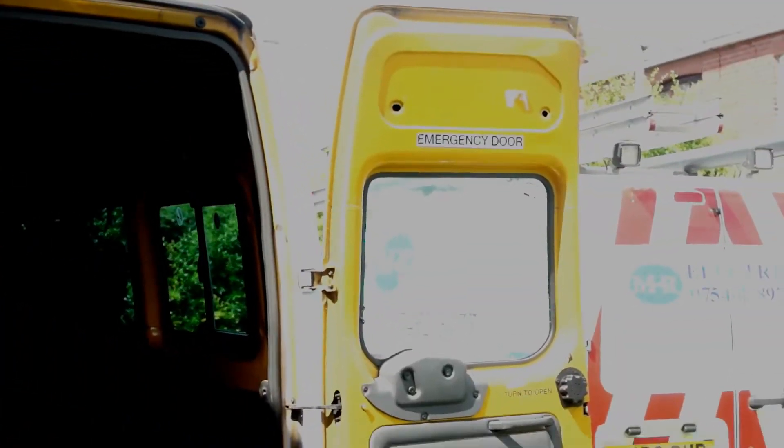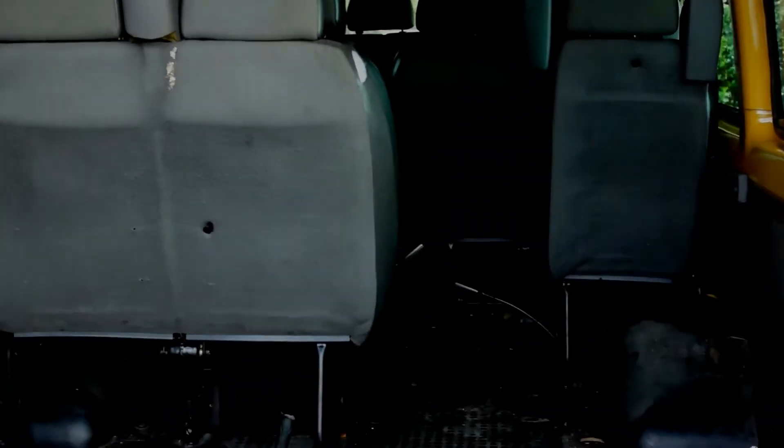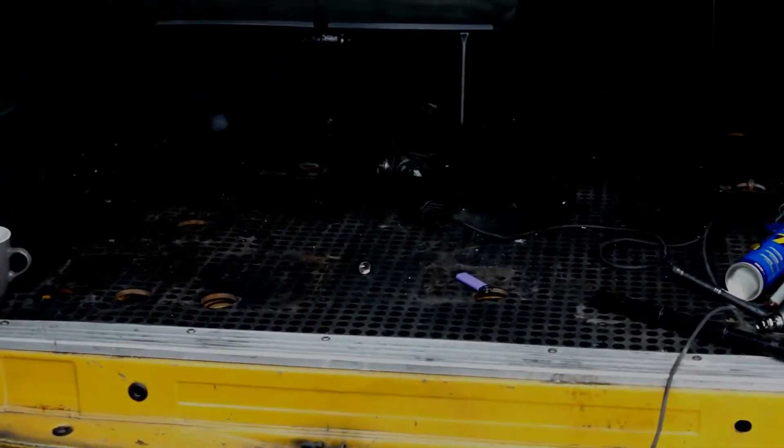As you can see, all the doors are yellow on the inside, which doesn't matter because it's going to get covered in carpet. I'm taking the seats out — what a nightmare that's been. Some bolts are coming out fine, but I've actually snapped three T50 Torx bits — a proper half-inch one and a Snap-on one — so I'm having to resort to the angle grinder.